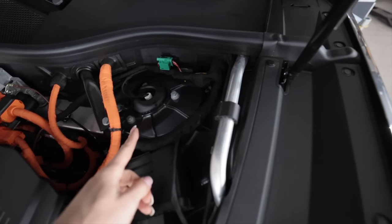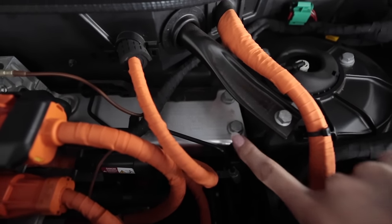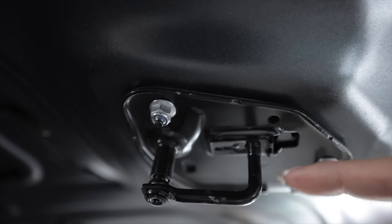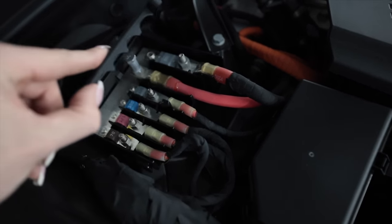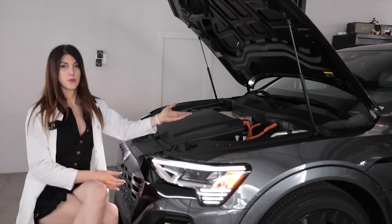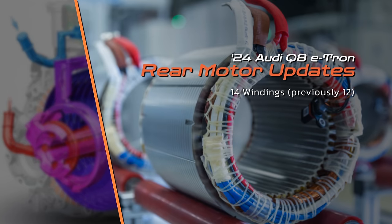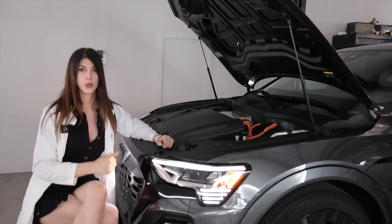You can see that front electric motor inverter mounted front and center right up top. That's actually the top of the strut tower — so inverted. No wonder this thing handles well; there's a massive aluminum brace between the two strut towers, plus another brace underneath the wiper cowl. This is an example of the build quality of why I like Audi products — look how detailed this hood latch is. They could have made it out of cheap stamped steel, but it's got an individual little loop that is replaceable. There are several heat exchangers as well as the AC condenser, because the stator, bearing plate, and rotor are all liquid-cooled in addition to the battery. For 2024, the rear electric motor has been upgraded to produce more torque with less required energy.